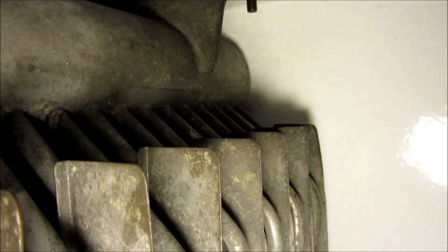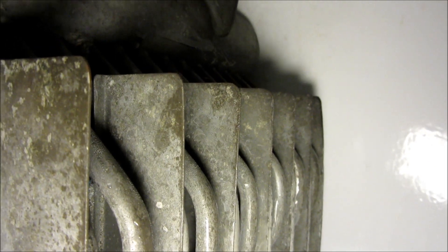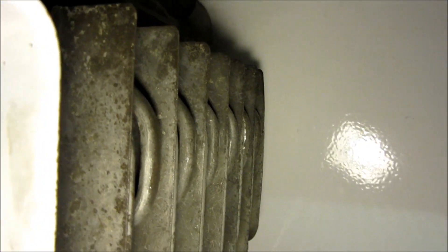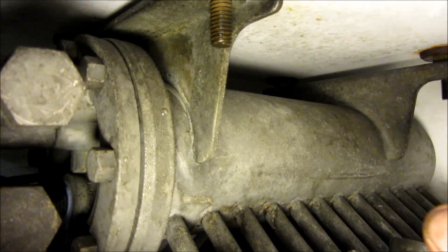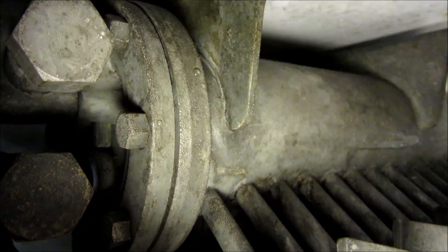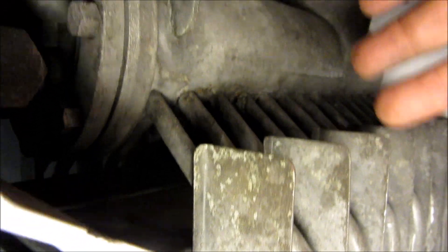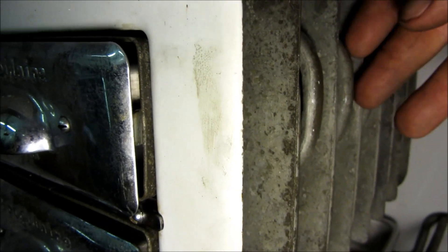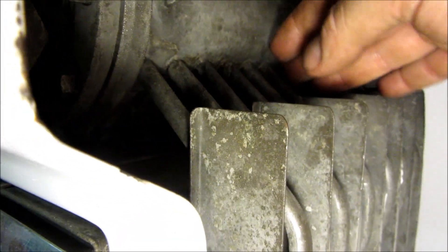These flooded evaporator systems have so much refrigerant liquid in them that sometimes it boils with a pop or a thump — it sounds like when you drop water into pot cooking grease. The way it was explained to me, these were designed for an oil and refrigerant that don't blend together. The oil floats in a layer on top, and the position of the float inside is such that oil floats up and goes down the return line back to the compressor without much liquid refrigerant flowing back. Because the oil and refrigerant are in layers and aren't mixed, you get that same popping and thumping sound as water falling into hot oil.